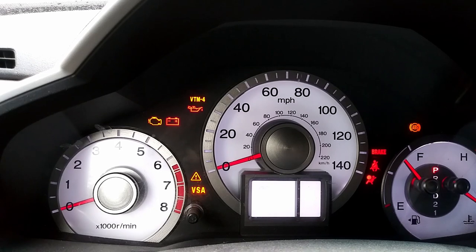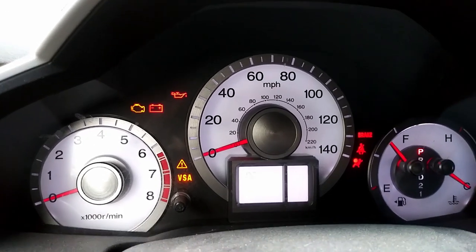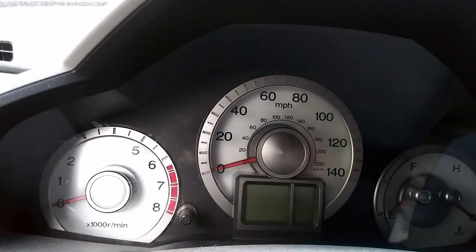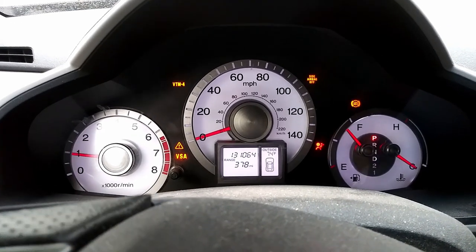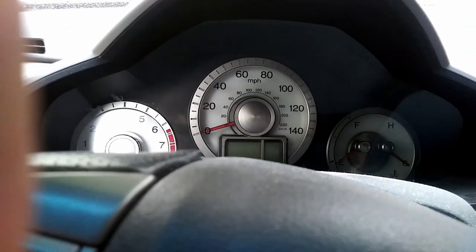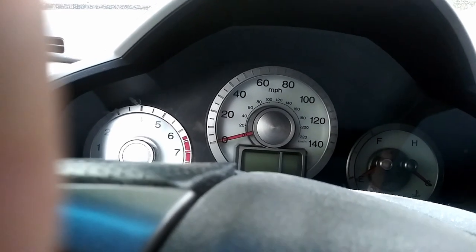The VTM4 is just blinking regularly. Notice it says 'no' on the odometer. Well, I think this is the ABS problem and that's what I'm going to solve. I'm going to turn off the car, pull that paperclip out, and then when I start the car, it still gives me all the lights — car still starts — but it's not throwing those codes. The reason I did the paperclip thing is I was going to buy a scan tool, but I'd read that a scan tool won't necessarily even tell you all the codes for the ABS system, because that's a separate system.